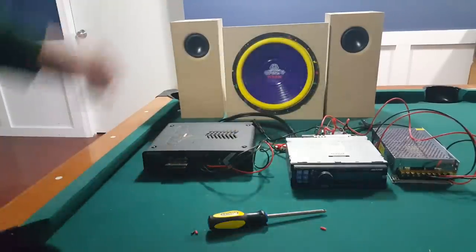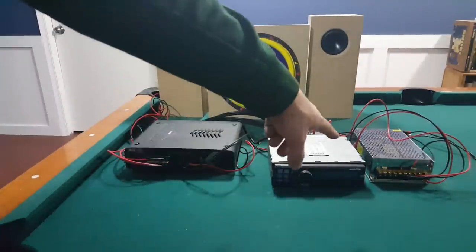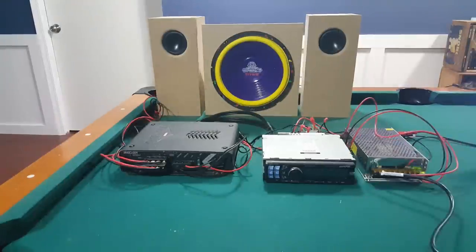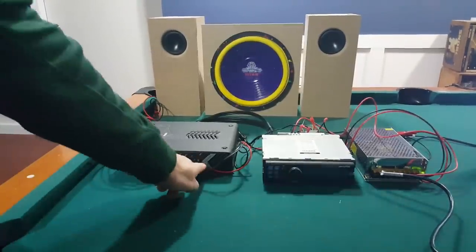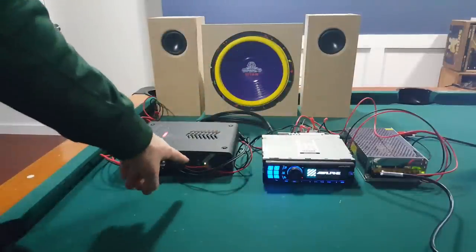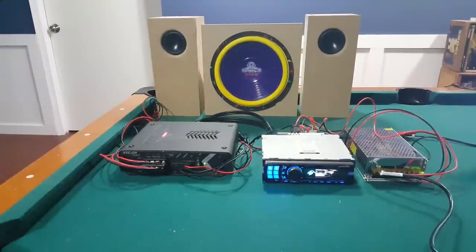The only thing left to do is plug up the speakers and we're good to go. I've hooked up the subwoofer and all the speakers, and now I just have to hook up the power to the wall to give everything its power. Let's turn it on. As soon as you turn on the head unit you should see a light on the amplifier turn on — and there it is, the amplifier light turned on. Now all we have to do is plug into aux and press play.